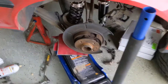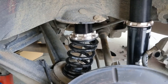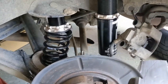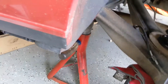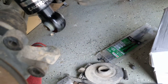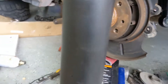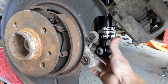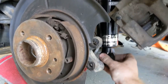Once you get the spring in there, I went ahead with the highest adjustment possible - I'd rather have to adjust it lower than higher. Then we grab a separate jack, crank it up a little bit, and put some tension on the spring. What we're trying to do is get the bolt hole aligned, then adjust it down to the bolt hole and make sure it's a similar length to the other side.